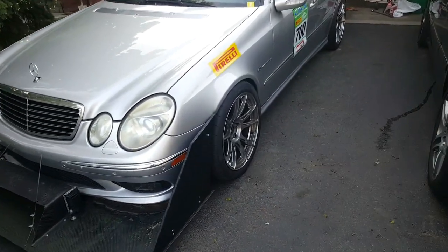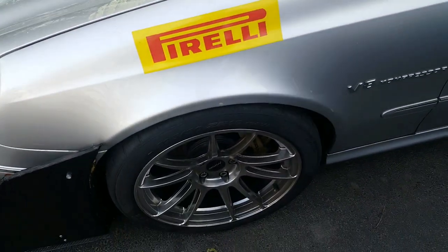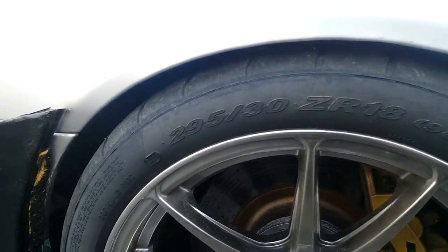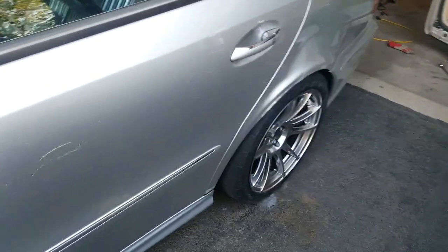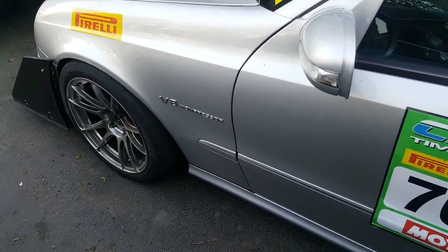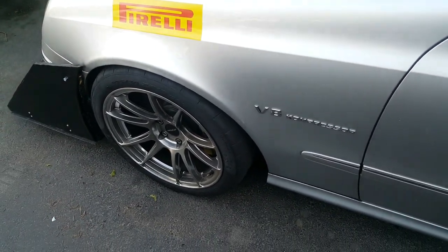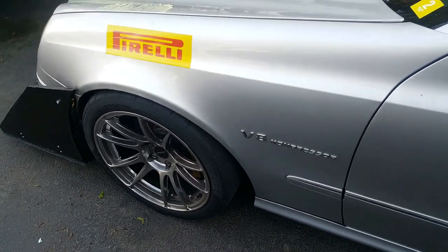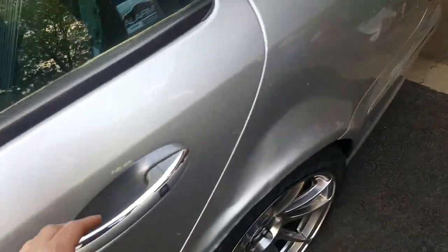Okay, so part 10, and there's a couple of changes we made to the car — not major changes but still significant. We've put 295 tires on the front now, so the car actually has a square setup with 295 at the back and at the front, which changed the balance a little bit. Before this we were at 245 front tires and they had really bad understeer.